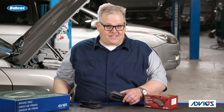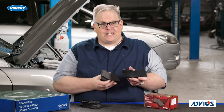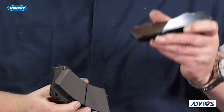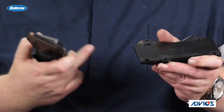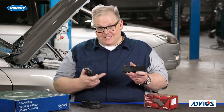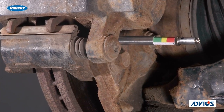But this set of brake pads takes it one step further — these two brake pads have the squealers in different positions. Typically, the squealer in this case wants to be on the leading edge of the brake pad. The rotor is going by here and creating that noise once the friction material gets worn down to two to three millimeters, and it can change depending on the vehicle.